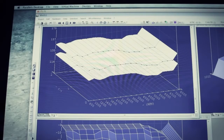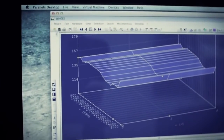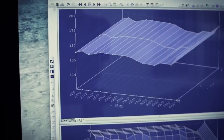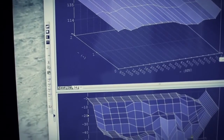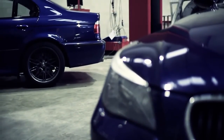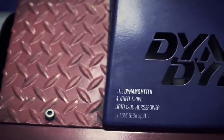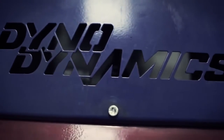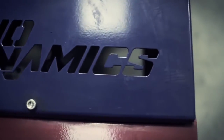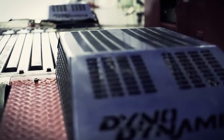We learn how to adjust the maps based on lots of research and development on our dyno, testing variations of ignition timing, fueling and intake VANOS. Without the dyno, we would be development tuning blind, not knowing exactly the delta in power across the RPM range without knock being a factor at this level. The dyno allows us to control the testing environment as much as possible, and to run the car at speeds which would get us into trouble on the road.